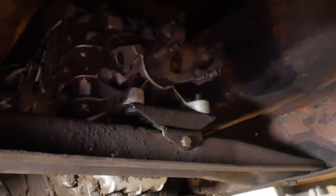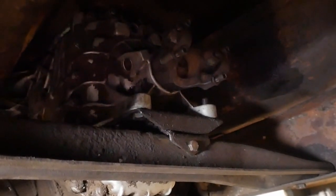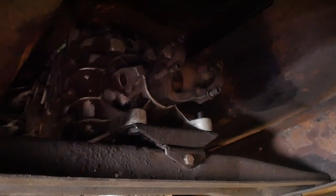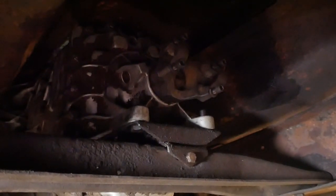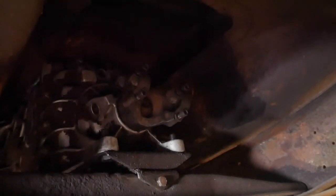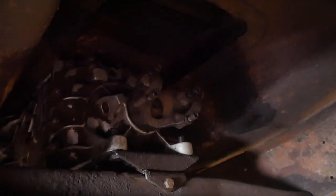Oh, one more thing I haven't shown in video yet. And that is that Powers has got the transmission mounted using the original crossmember from the truck and the original transmission mount from the NP435. Bolts right into the ZF5. Just needed some new holes drilled into the frame here in order to be in the right place, but it is good and set and ready to go.